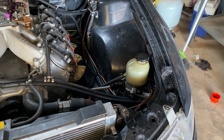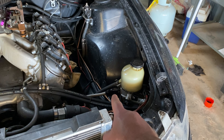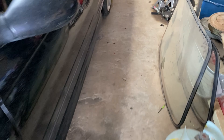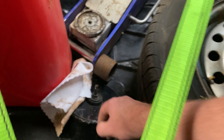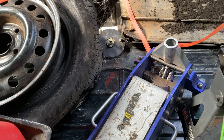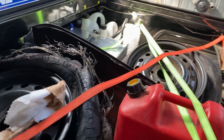It's also running the Astra power steering pump. After a lot of trial and error, I finally got it to hold that pressure line because that's the one that kept blowing off. It's got a little bit of work done in the back — custom towers. It's got R33 coilovers in it, one on each side. And it's just running a 60-litre fuel cell.